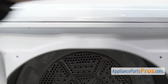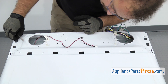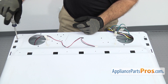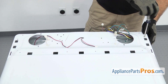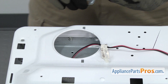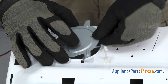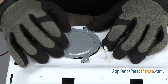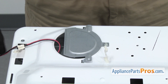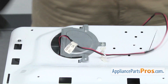Once you have the screws in, we can close the door. Now we can put the screws on in the back — just line them up and put them in, then use the Phillips screwdriver to tighten them down. Now we can put the covers on and route the wires. We're just going to put the feet down into the little openings, then use the quarter inch nut driver to put the screw in. Then grab the wire and run it through the holder and lock it in place. Once you have this one done, you can do the other side.